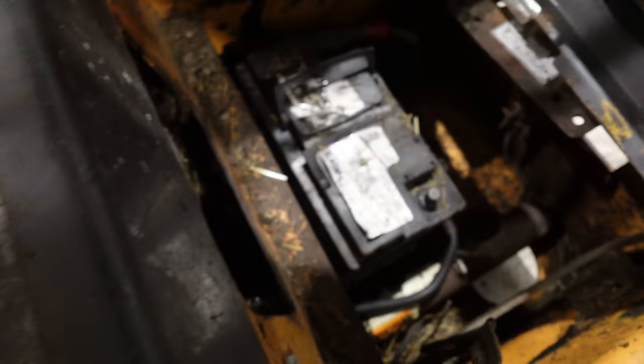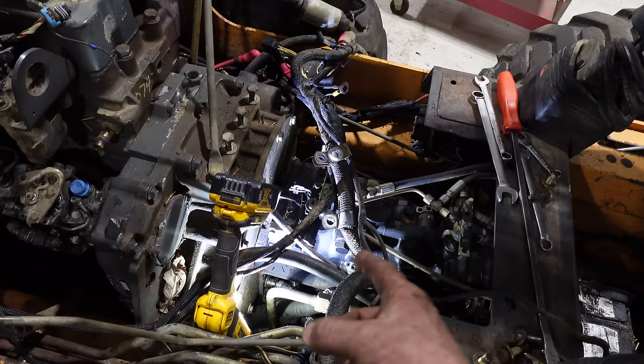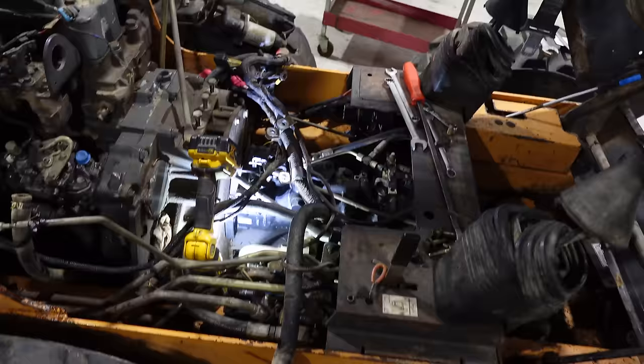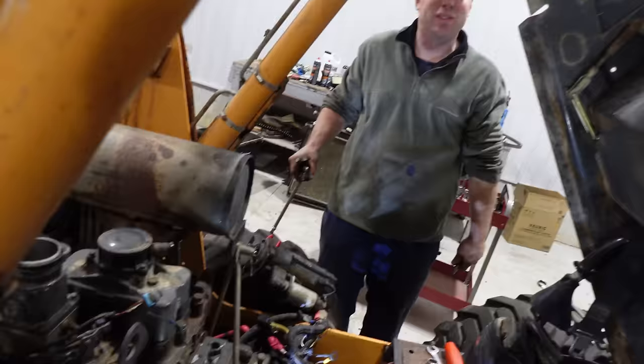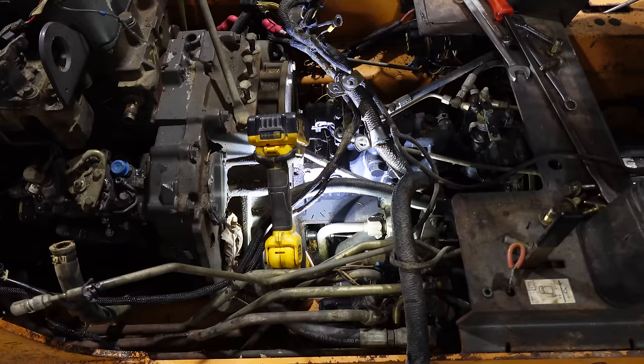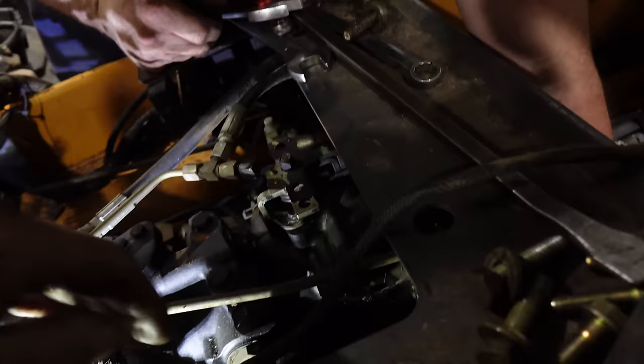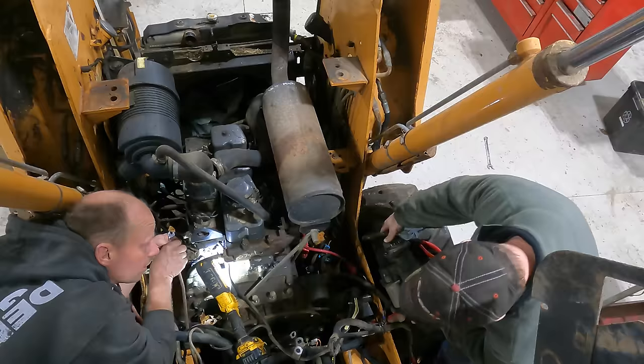So for that plate underneath, we just put extensions all the way through the front and a bar on it, and you can get it. There's two on each side, four in total. Top ones are 18mm, bottom ones are 16mm. A lot of cheap wrench sets miss 16 and 18 - they go 15, then 17, then 19. Those wrenches are so tight there's no way they would work anyway.